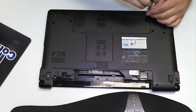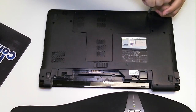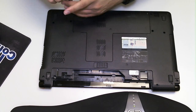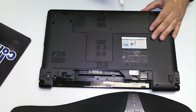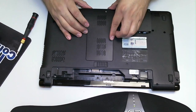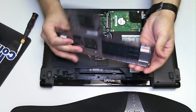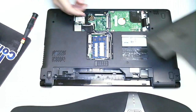The first thing I'm going to do is go to these three screws here and unscrew those. If you might have seen my other video, I did the hard drive removal before this one, and you'll see how easy it is to remove the RAM. You unscrew these three screws and take off the bottom panel by snapping it off. You want to be gentle — you don't want to crack a panel. Note that these screws don't come off; they stay inside, kind of like what Mac does.